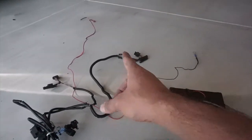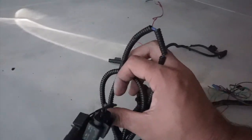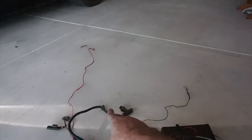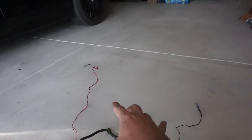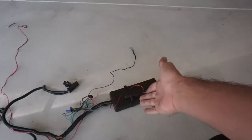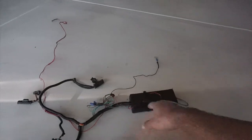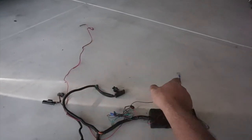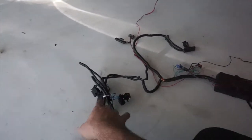This is the JB4 I bought. My car is a 328i 2013, and on the 328 you don't need the blue wire or the black wire — you only plug in the brown one and the colorful one. The red wire gives you electricity for the tune. This is the Bluetooth controller; I got a pretty good deal and bought the whole JB4 kit used for around $200. The blue and black wires are only for the 320i.